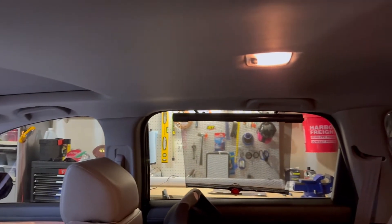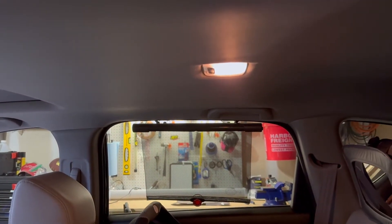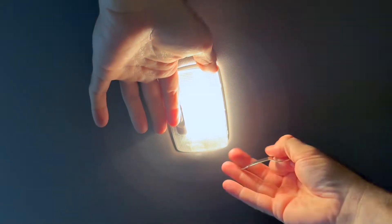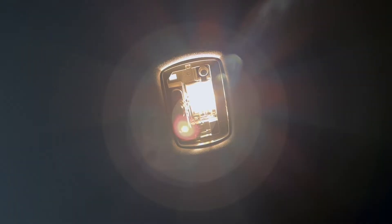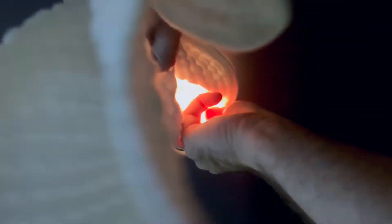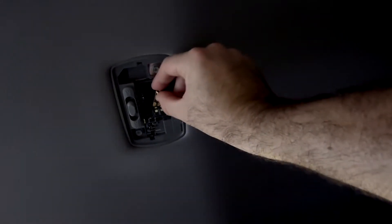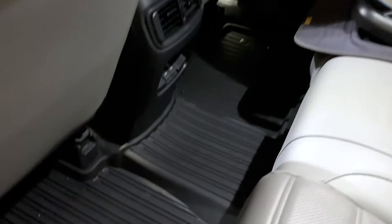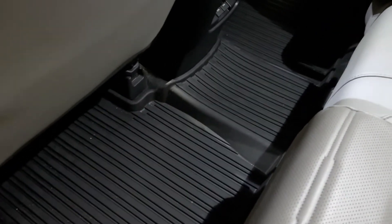You can see the LEDs up front and then the pitiful halogen back here — let's go ahead and fix this one. Back here we're going to pop this loose. You need a much smaller tool to get up in there, and now we've got it loose. Make sure you get your hand protection and pull that bulb out, then stick the new bulb in and put the cover back on. It's perfect — I can now actually see in my floorboard. That's pretty awesome.